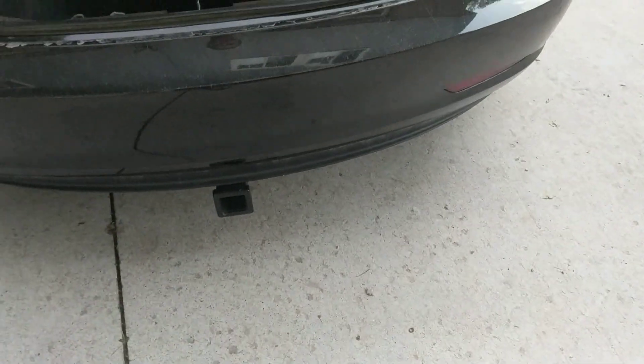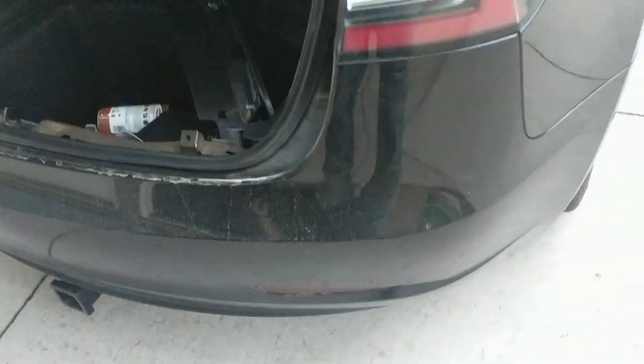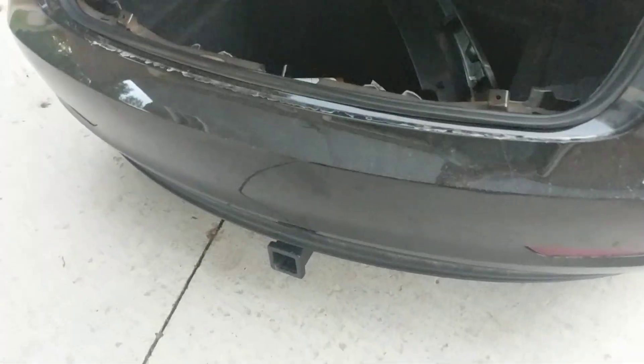There's a screw on one side of the felt piece and the other, and then this is sort of like a big clamshell that slides out of the way. I threw some blankets down on the floor and moved this out to the side. Behind this piece are more ten millimeter bolts — you're gonna take off a plastic flare and disconnect about two or three things. You just pop them off, give it a pull, and the whole bumper will come off.